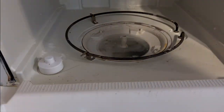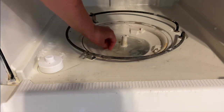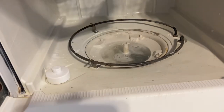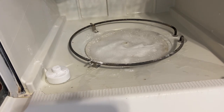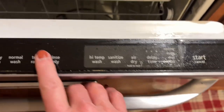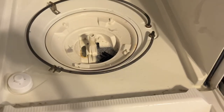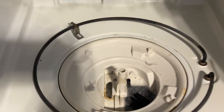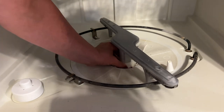My first thought was Drano, but you don't want to put Drano in your dishwasher. After feeling around I didn't find anything actually clogging it, so I grabbed vinegar and baking soda and went to work — put baking soda in and doused the whole bottom with vinegar. Then I set the dishwasher to a rinse cycle, shut the door, and let it run through. When I came back I was so happy and shocked — it absolutely unclogged it. Vinegar and baking soda really works, and I had never taken all of this apart before.